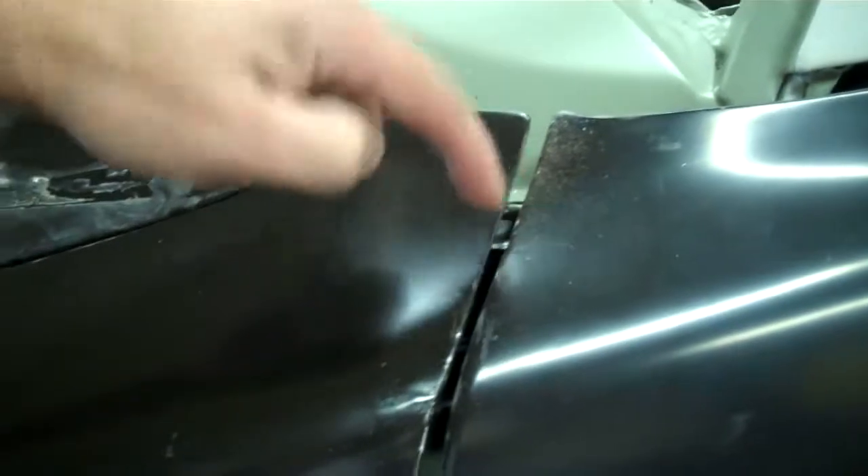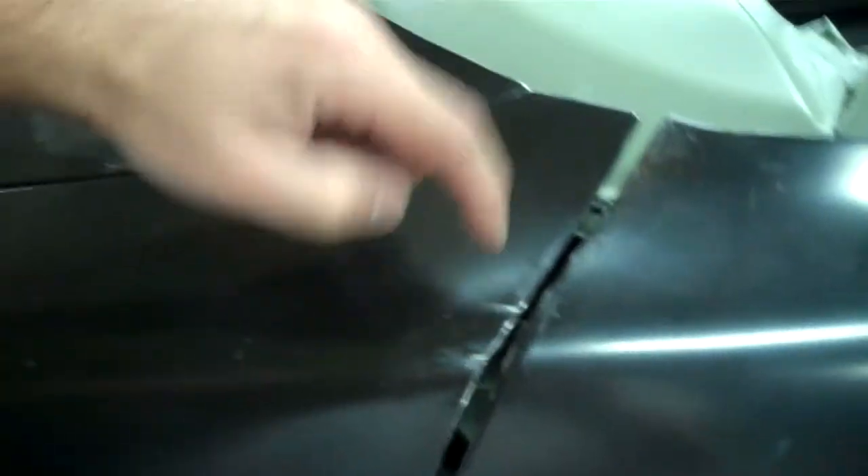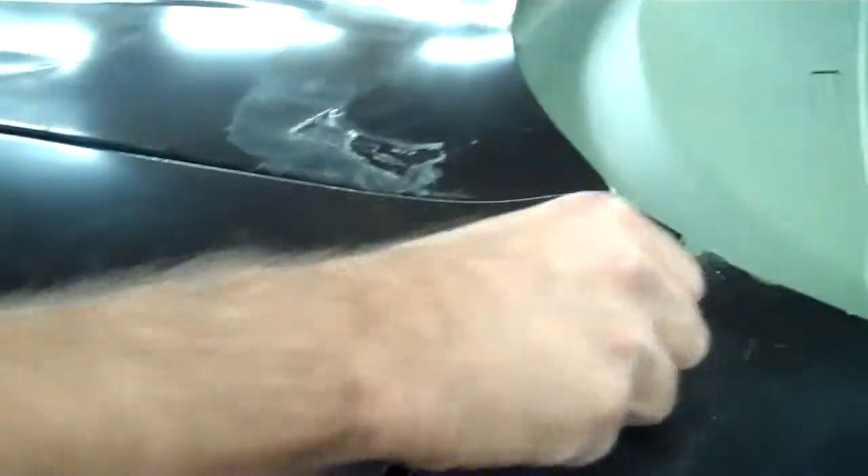You might be able to see the reflection of it — yeah, you can see it when you go down. The other issue are the gaps. They do require a little bit more work than two factory panels that were made for this car. As you can see, it's a lot tighter right here and wider up and through here. So we're going to have to grind away on one of the edges, either the fender or the door, re-weld the edge, grind it, and perform body work.